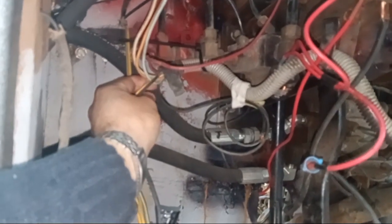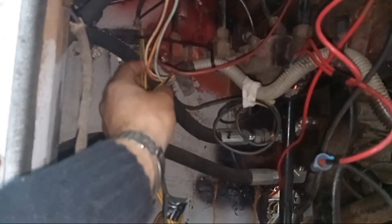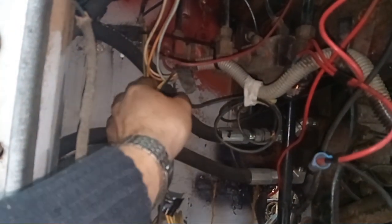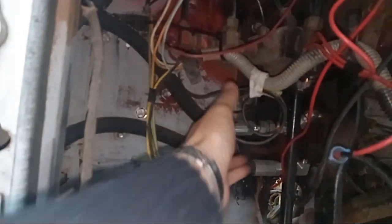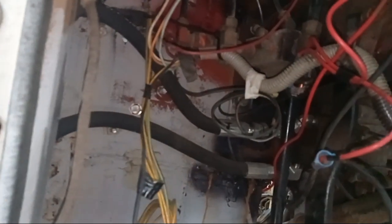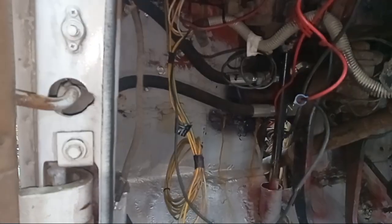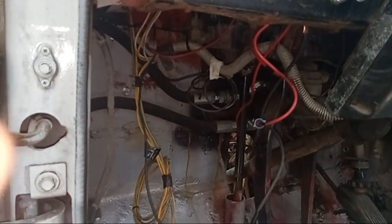As you can see, this is the harness, and there are seven or eight wires coming out of it. One wire is for the horn, and really — excluding the horn — there should only be three wires: an input wire for positive and then one for each turn signal. So seven is really odd.